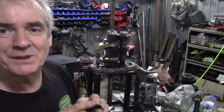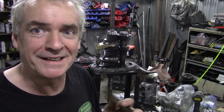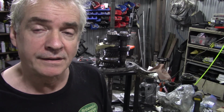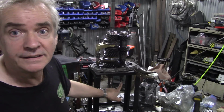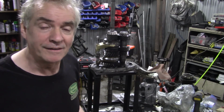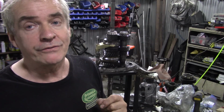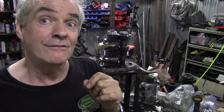But like I say, you can't put solder on them and build them up with lead. You can't do anything with them really. Now, talking about building things up, if you cast your mind back when we took this box apart, the bearing for the lay shaft that goes onto here fell out of the housing, and I'm almost sure that was the cause of the noise. It probably is, and unfortunately that bearing sort of renders the whole housing scrap.